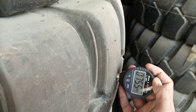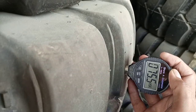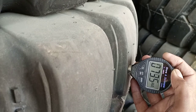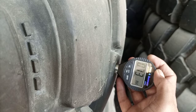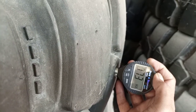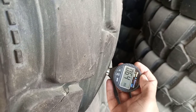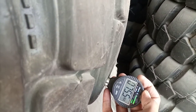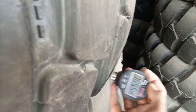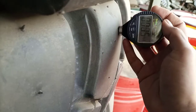The hardness should be in the range from 60 to 70 or so — not too much less, because this is a tire, not a bag or soft rubber item, so it should be in a reasonable range. As you can see, 75 is the reading for this tire — that's okay.